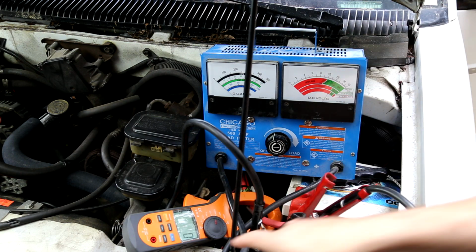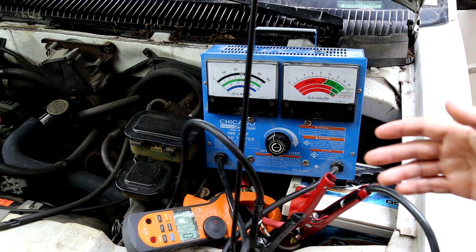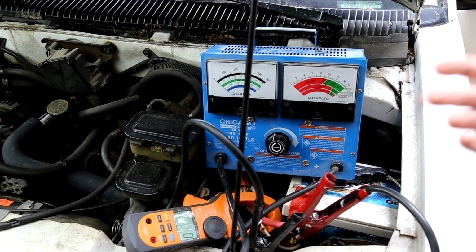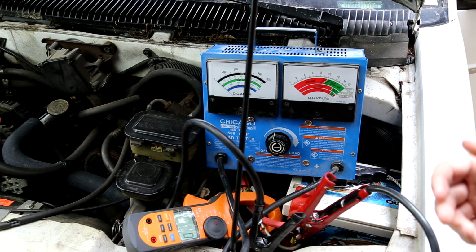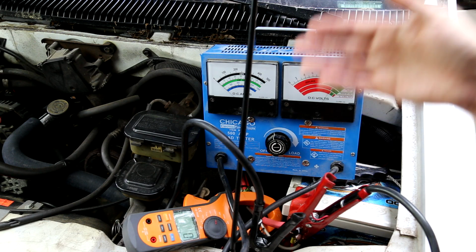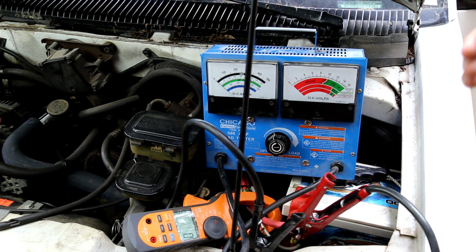342 amps tested out of this current clamp out of one of those alternators, and that's 370 amps cold rated. There's also a hot rating that DC Power does. Not everybody does that. It's usually substantially less, but nevertheless 340 amps, very respectable. That is an ample amount of power, and there's two of them, so I can support a ton of electrical on here.